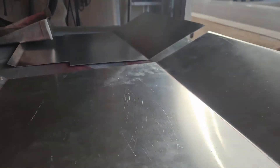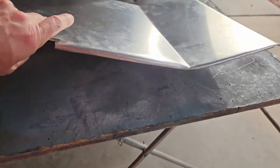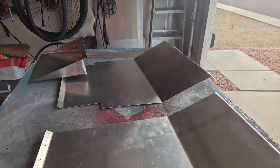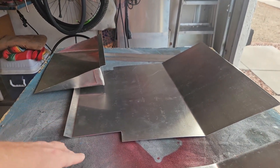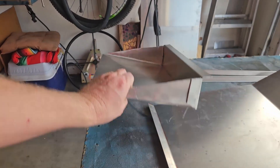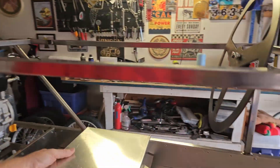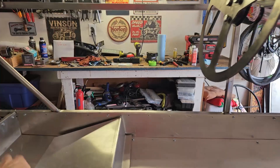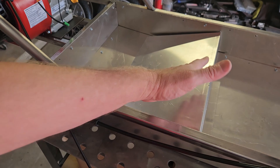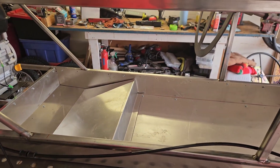Let me get this blower out of the way. So here's the seat I made — I've curled the piece of aluminum around the edge just to strengthen it, and that works pretty good. I made a second piece that I'm going to install and curve over that metal bar — this is the seat bottom. This goes in the car about like that, so you basically have your bottom sitting on that, giving a little support for your legs and feet so they're not stressed out sitting on the flat bottom.